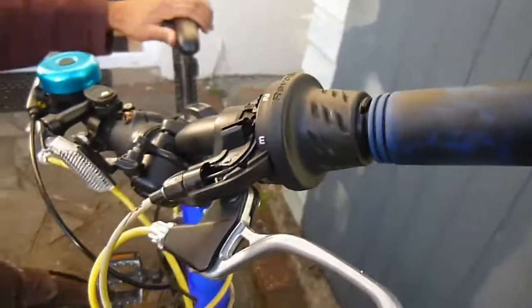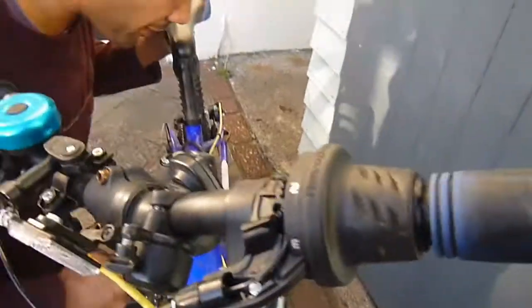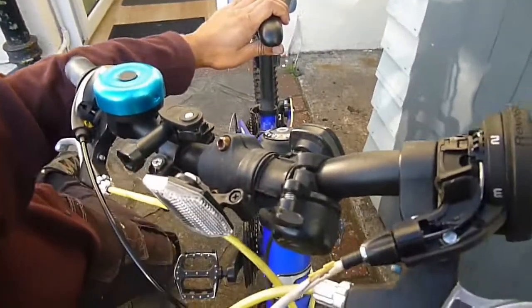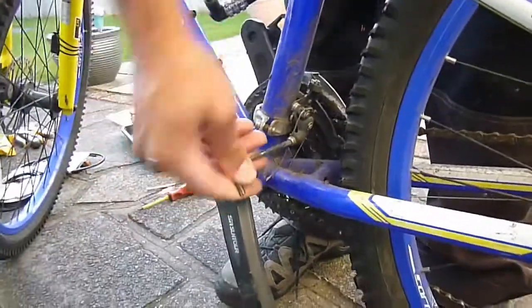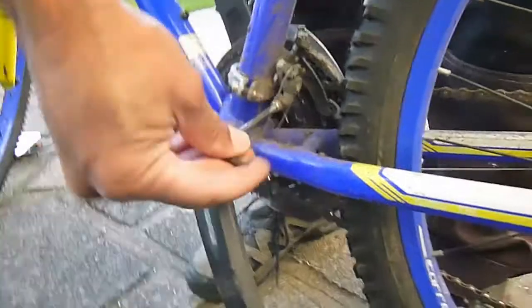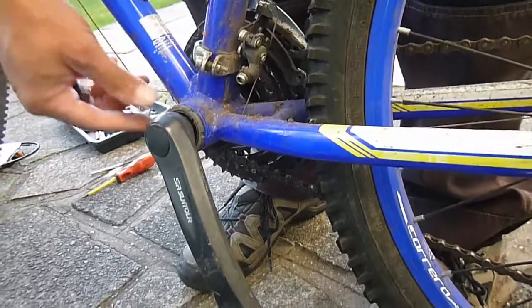And then we'll take the cable off at this end, which is just fixed by another Allen key. Bigger one. Okay, so let's whip it out. You'll notice I always leave it on what would be the loosest gear, so the cable's really loose on the smallest gear there. So just whip that out, pull that cable out, pull it all out there.